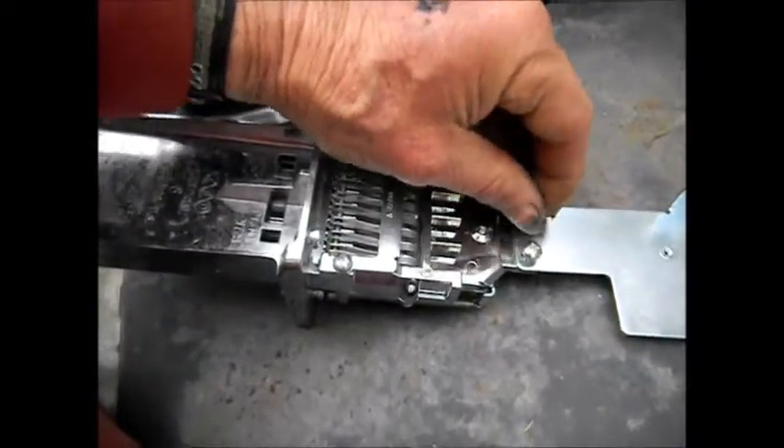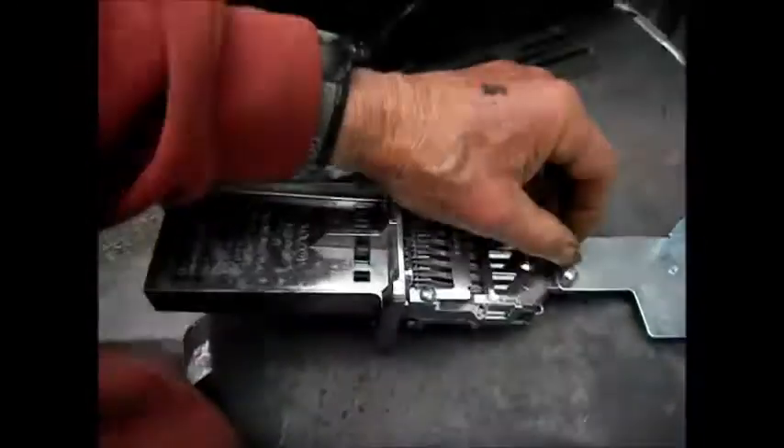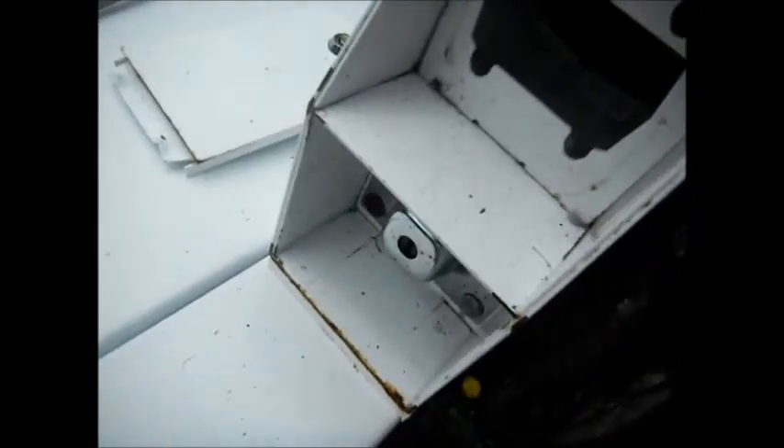Also, if your coins are not cleaned out, they will jam the slider up. So if your coin box is full of coins, basically they're going to be backing up. This thing here is the coin guide, basically. And we need to make sure that it's sitting where it should be. You can see it's got little clips on it that sort of hold it in place. You could probably glue it in place, but it should be right about there.